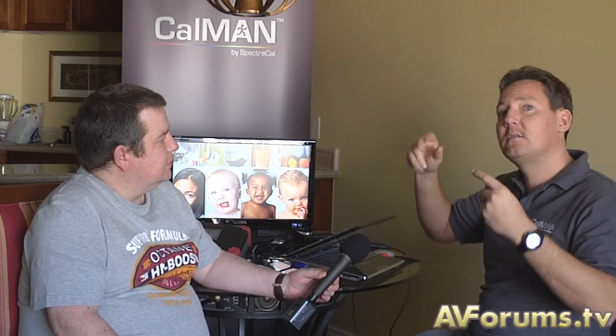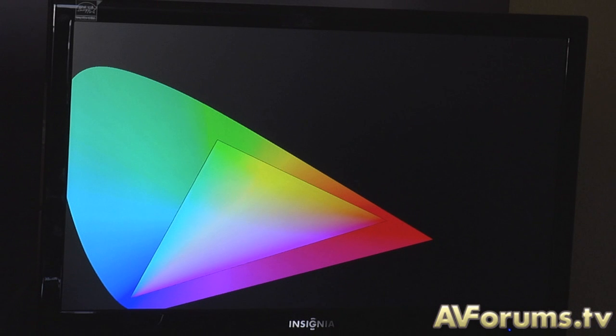Let me go ahead and set up a demonstration. What we're going to be doing is bringing up a chromaticity chart that shows basically what a display is capable of producing. We're going to display all the greens, reds, blues, all the magentas, cyans, yellows, and that whole spectrum. Then we're going to show you with the video EQ how much control we have over that. So we're bringing up a chromaticity pattern to look at all the colors the display is capable of producing. Often when a manufacturer ships a display, they're taking your reds, blues, and greens and oversaturating them.